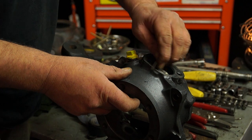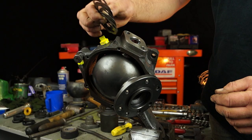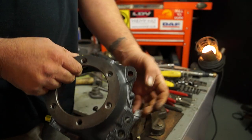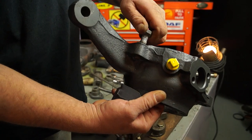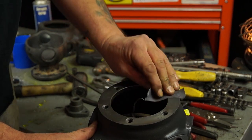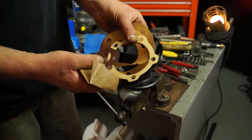On the top pin where the shims are going to go, you also want to clean this off — at least get the paint off so you know you'll get an accurate measurement when you go to shim it up. Likewise for the caliper brackets — they shouldn't have any paint on them. I've also loosened off the stop lock for the steering. The idea is to get all mating surfaces clean so we get good joints when we fit everything back together, and can just use paper gaskets instead of any other gasket sealant.